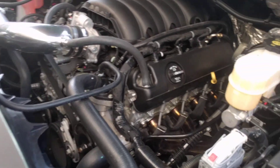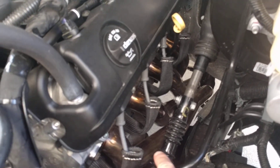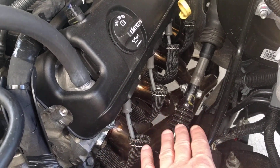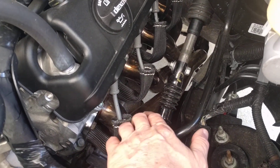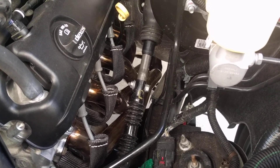After your steering wheel is locked, go ahead and remove the steering shaft — this bolt here, bolt down there, pull them both out, jiggle it and it'll come right out. That'll allow you to remove the heat shields — there are three 10 millimeter bolts on each side. Remove the heat shield off the manifold, that'll give you more room. Remove the boots from each spark plug and I would go ahead and take the cover off and remove the wires from the coil packs as well so you don't risk damaging your brand new wires.